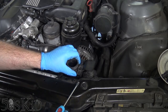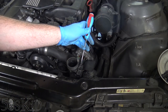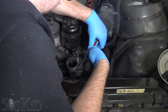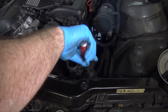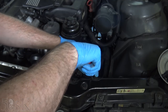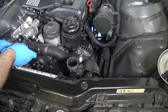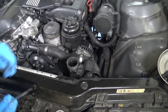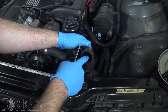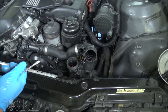Now we're going to take this top radiator hose off. There's a little metal tab you had to pull off right here, and there's another one right in the back right here which you're not going to be able to see. You should just work it up in the same way. Work these hoses back and get them off. If you've never had them off, it's going to be really difficult, but you just have to pry. One trick is to spray some silicone spray in through the gap and hope that it makes it in to the O-ring — that's what gets stuck onto the plastic parts after so long.